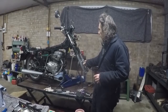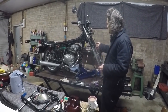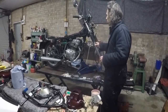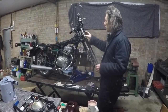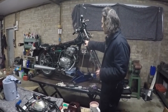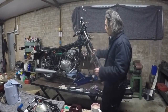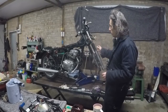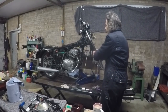I've done the other leg exactly the same and fitted the gaiters. I had a mock-up with this bracket, just held it up to the bike, and I noticed this front leg was probably just going to touch here when it's on the bike. There was a slight bit of a lump missing out of the lock stop — that's what stops the bars from going right the way around. I inspected the lock stop on the frame and it had a little lump out of it, so I put the wheel back in, took it to my mate Jay, and he just tack-welded a little bit on there. I'll touch that in with black frame paint — I use black paint for wrought iron gates because it goes straight on without priming.